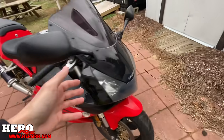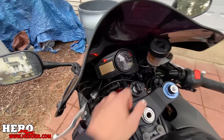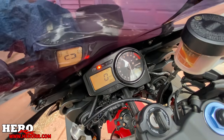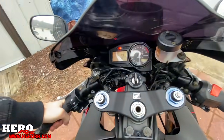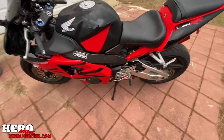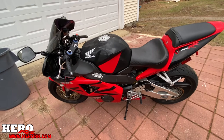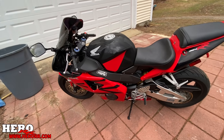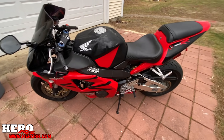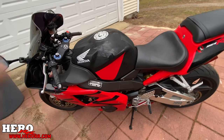My friend came over and I went to show him the bike, and an issue immediately occurred. That noise is the LED lights, but look — it says it's not in neutral, yet the bike is in neutral. It won't even crank because the kickstand is saying don't crank. So the neutral switch, or something with the neutral light, is not working. It kind of sucks because it was working when I looked at the bike and now it's not. The bike was completely good when I went to see it — it ran great, did everything fine — but the issue started occurring pretty soon after I got home.